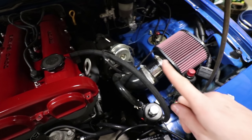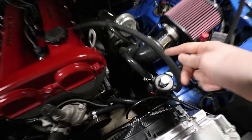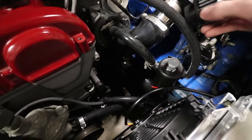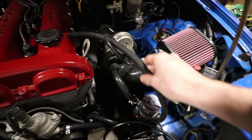So I was driving the Miata and I noticed the AFRs were looking a little different. In full boost it was about 12.4 instead of 11.8, which isn't a lot but it's a difference. And I was thinking to myself — we didn't do anything crazy. All we did is put a plate of metal on, add a catch can, paint something, and get rid of a big tube. But then a thought occurred to me: we put the catch can in between the intake and the valve cover. Before we put it on there, no air could come into that tube because it was all sealed off. But now there's a breather valve, so air was coming through into the breather valve, into the turbo, thus making it leaner. That is my guess. To test it, I put some duct tape on the breather valve and put the cover back on. Now it's just like it was before — there's no air coming in anywhere along this tube. Let's go drive it and see if it fixed it.